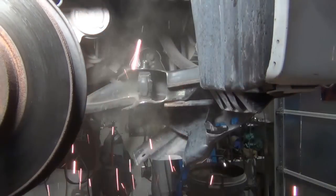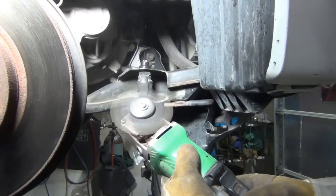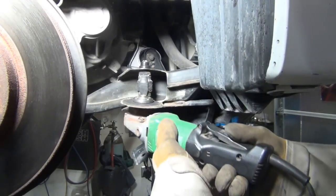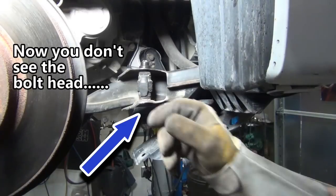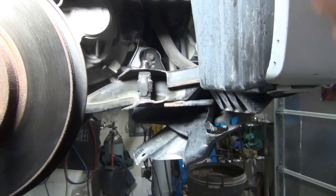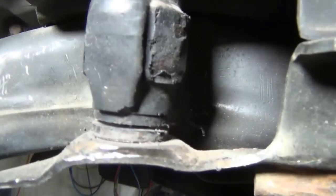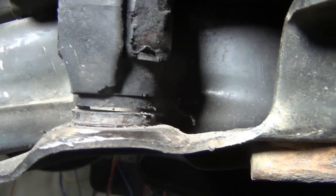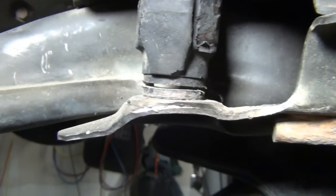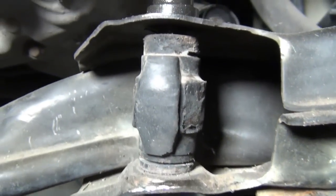I was just about to say we're going to kick, and before I could get it out of my mouth, I'm not kidding, I was about to say that. We hit the steel and it kicked back just like I was talking about. So it's time for a new blade. I'm going to check and see. Another reason for it to kick is we are all the way through there. I think it's hanging on by a nothing, so I'm not going to bother with that. I can break that by hand or with a pry bar.